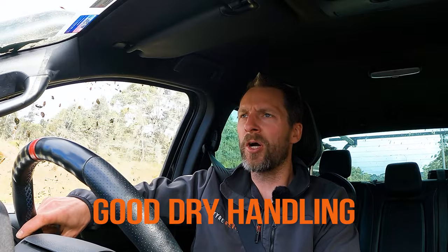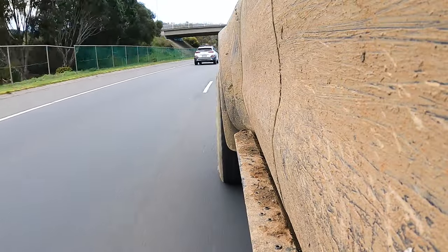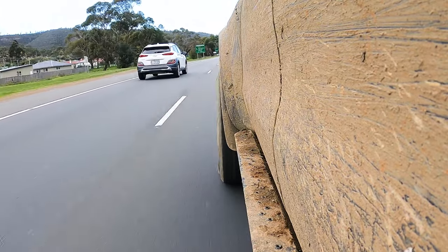We're on the highway now, and this is where we answer a lot of the questions you might have, because most of you will spend most of your time on blacktop. Dry handling characteristics are actually really good. I had to borrow a new Ford Ranger XLT the other day and noticed the highway terrain tyres understeered badly — if you pushed it a little too hard into a roundabout, the nose went out. These tyres are a little bit wider — I'm running 295/70R17s — so there's more tread on the ground. Their dry handling is pretty good. If you really push them you can unsettle them, but don't drive like that.